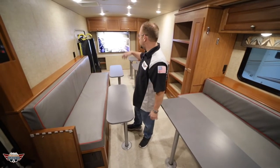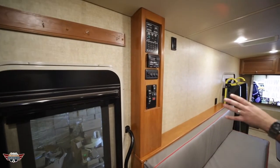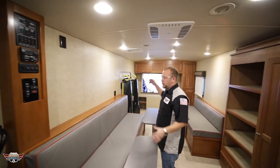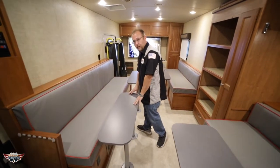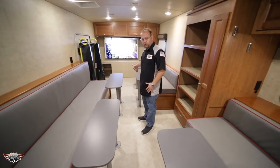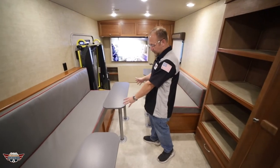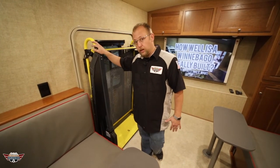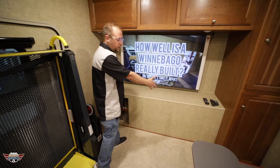We have a booth that spans from the entry door all the way back to the wheelchair lift. We've tucked in all the wires, relocated all of the switches right here by the entry door — when they used to be over here — making it look like it was designed to be that way. We've built booths accented by individual tables that can come in and out as needed, with just enough space to walk through. Holes in the floor so if you take them out you can walk around. We've relocated the heater vents underneath this booth, reinstalled the wheelchair lift, and built a custom enclosure so we could use the storage underneath in the back.